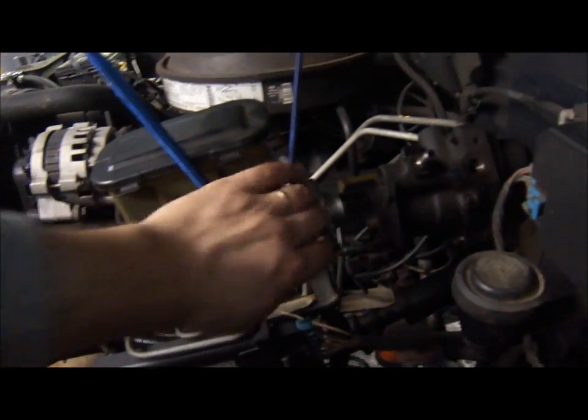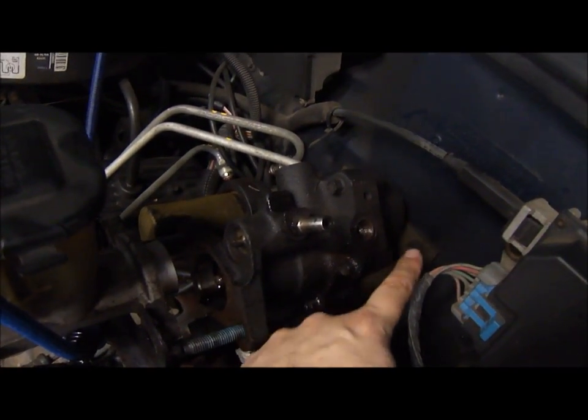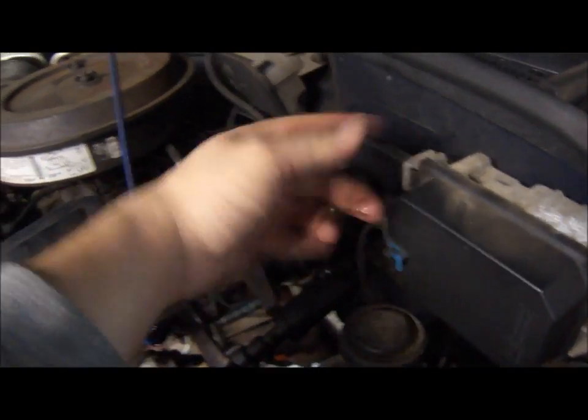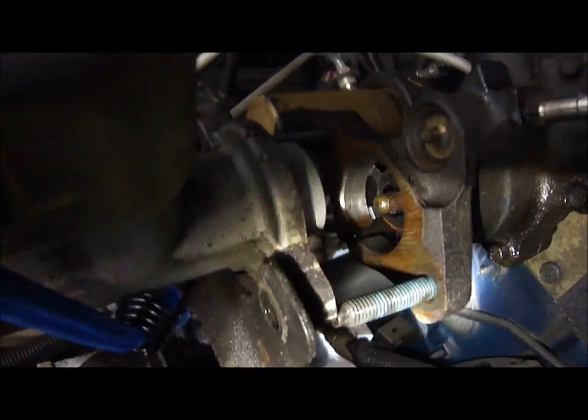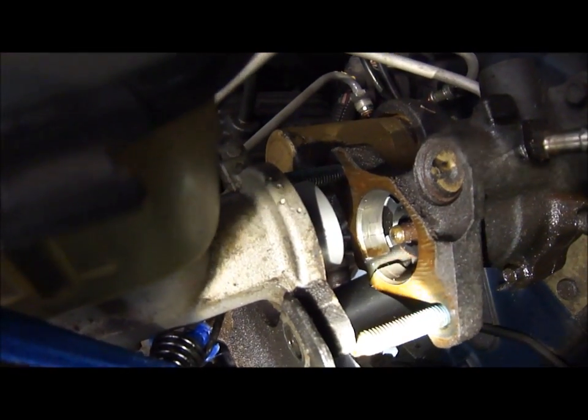So it's hanging off these bungee ties, and now it's time to get under the dash on the inside and remove the 4 nuts that are holding the hydro boost to the firewall from the inside. By the way, I should mention, a question is probably going to come up, that there is no gaskets or anything or any seals between the 2 units. Let me shine the light in there. You can see there's a little bit of power steering fluid oozing out of the hydro boost, and I would attribute that to the leaky seal inside the unit.